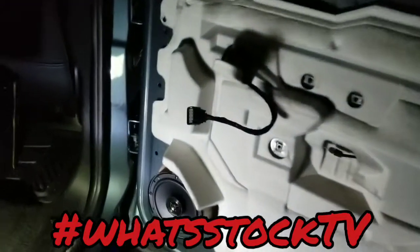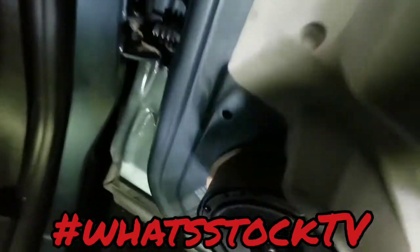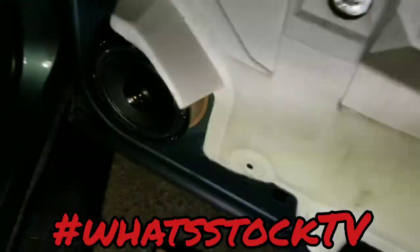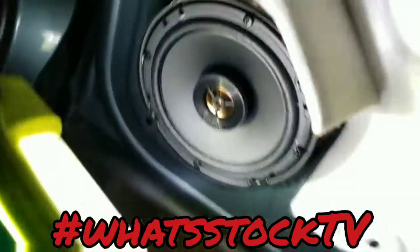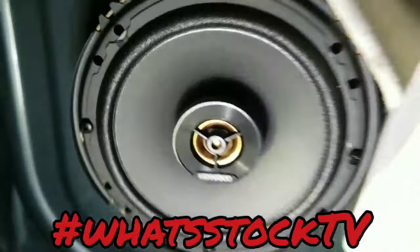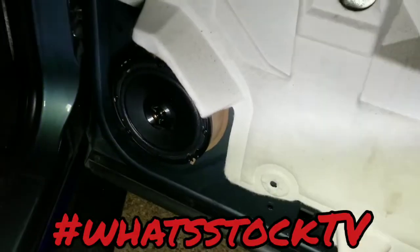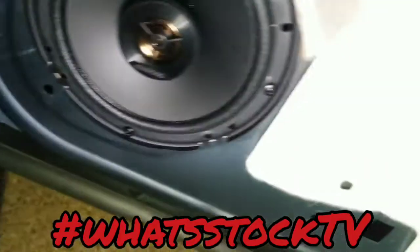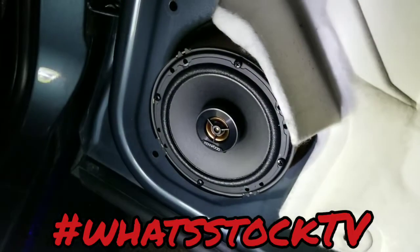What's up, y'all? So this truck is back here, but what we're working on today is some audio stuff. If you don't know, most of these newer cars and trucks have this big bulky factory speaker setup, and if you get aftermarket speakers like these, which are Kenwoods, you have to buy a whole new bracket for up in the mount, because there's no spot for the four holes to screw into the actual frame of the door like on an older model car.